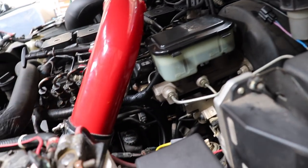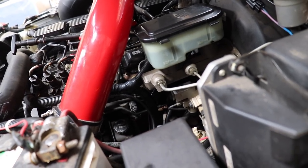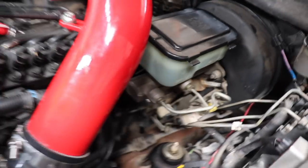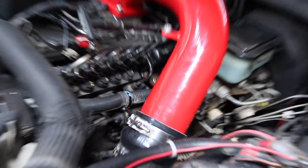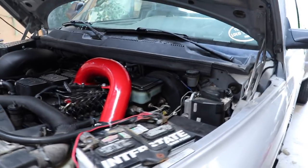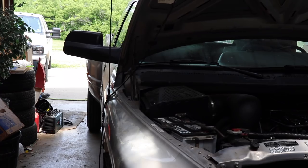So what I'm gonna do is get that part put back in there, which is down below here. I think I can get to it without having to remove anything except for the fuel shutoff solenoid itself. You can see where the linkage is down there, kind of the arm down there — right there, the two little bolts at the base. There's one little 8mm I have to take out. I think that's all it is, and then we can get to attempting to start this truck up and take it for a rip. Let's do it.